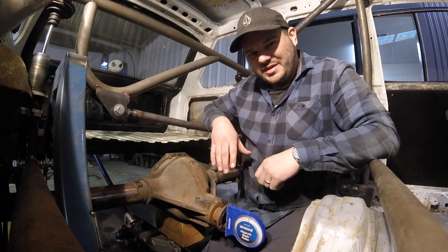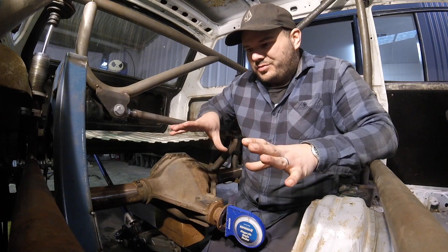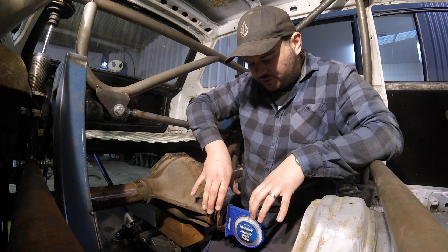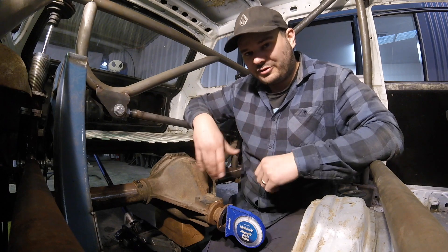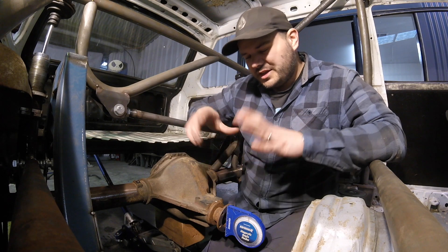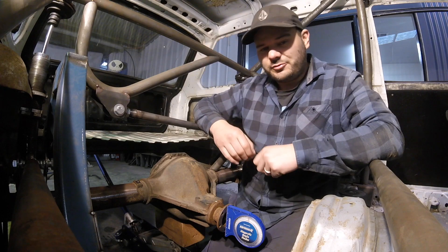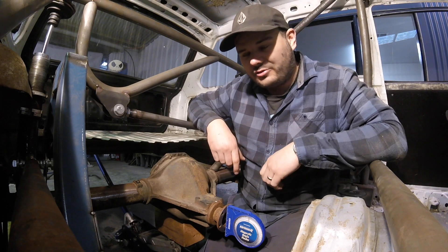I've been messing about moving things up and down and flat, and each side of the wheel, and I'm really happy with how it's all working. It's been a lot of messing about with a lot of information in my head and I've been able to get out and actually build it. As you can see in one of the shots, the pinion angle as you travel up and down through the suspension movement doesn't change — it just stays at a constant setting. I've currently got it just nose down about a degree and you can fine-tune that with the lengths of the top arms.